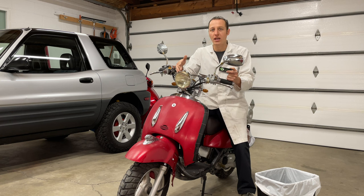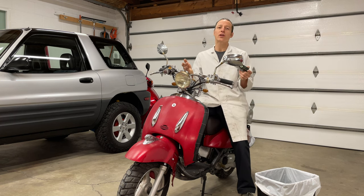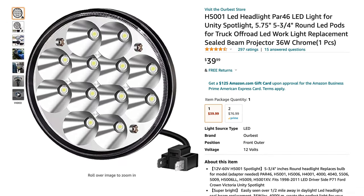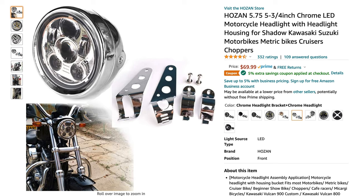Now I still want to upgrade this headlight to LED, so let's try something else. My scooter has a 5 inch headlight — that's not a standard size for a motorcycle, and there aren't any good LED kits available for it. I could replace the bucket with a 5.75 inch size and have more options. I could get this work light — it's 36 watts, but it looks like it's only a flood light, so it might be good for a low beam but it doesn't have a high beam built in.